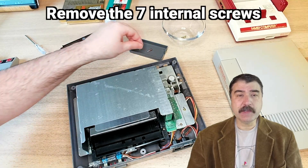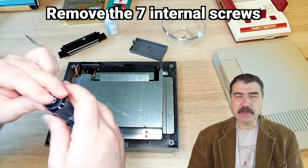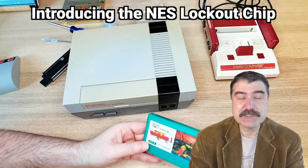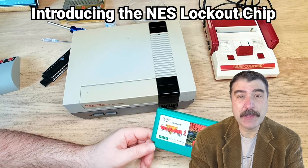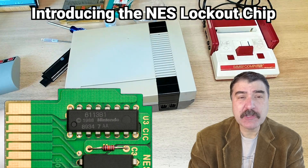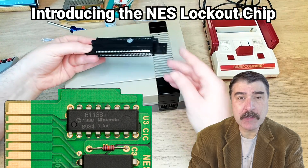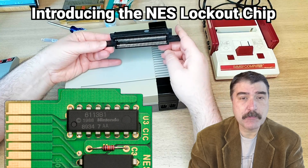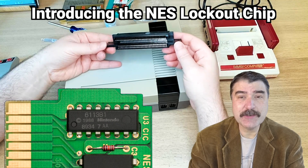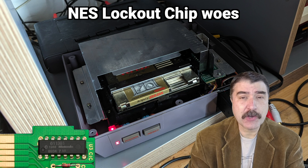The RF shield is held in place with seven Phillips screws, and you can keep them in a separate container from the external screws. The external screws are longer than the internal screws, but they're both the same width. While Famicom cartridges had 60 pins, the NES had a 72-pin cartridge design, and the additional pins were to help enable an anti-piracy lockout chip. Nintendo actually put a security chip inside each cartridge that the NES system needs to talk to before it will run the game. This was designed to prevent unauthorized cartridges from being produced, and while there still were unauthorized cartridges, it did slow their adoption and allowed Nintendo to run a very successful video game business in the US.